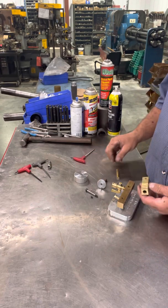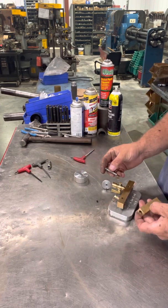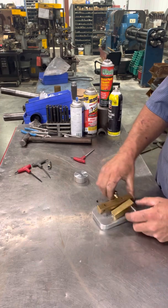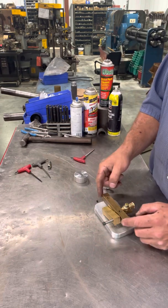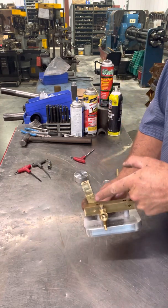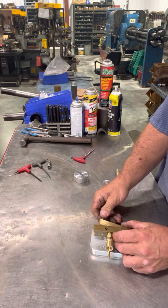Then the cylinder is held on. If you have the kit with the spring, put the spring on the shoulder bolt. If your kit doesn't include a spring and the bolt is shorter, don't worry — it works just as well, actually if not better. This goes through the cylinder and then onto the side of the engine. You can take sandpaper — there may be some sharp edges. The smoother the surfaces are where these two little holes are, and the smoother the mating hole is, the better this will glide together and the more efficiently your engine will run. They run better and better as they break in, but you can always clean that up a little bit.